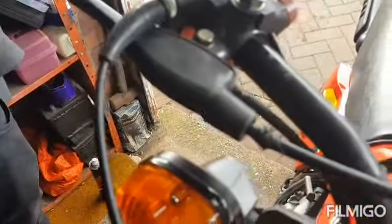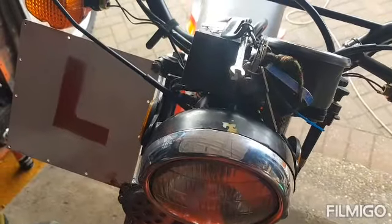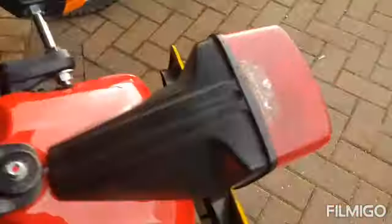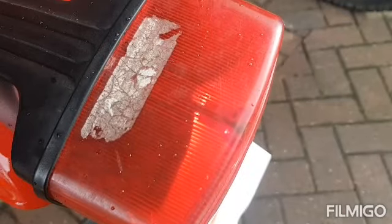We've put new levers on as well - new brake switch, both two new levers - because it had these dog leg things on and they weren't very comfortable for Tom to ride with. The brake light switch is a black wire and a green with a yellow stripe in the headlight - that's what you need to plug into. Just slip the ignition on Tom and try the light. Off... on... on... off. Oh, that's working!